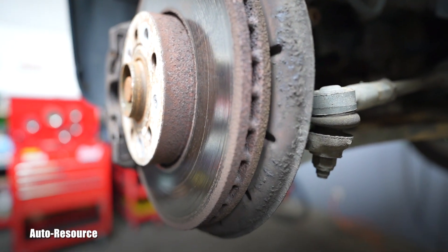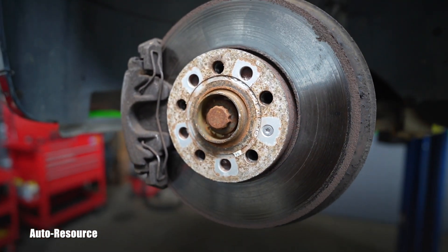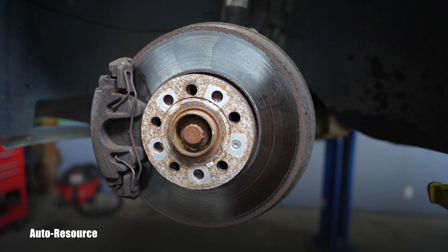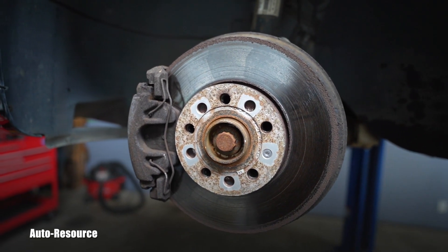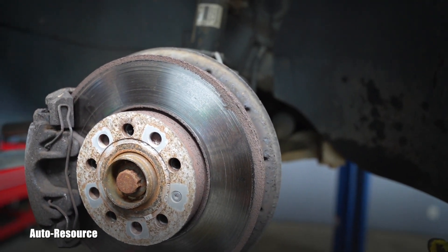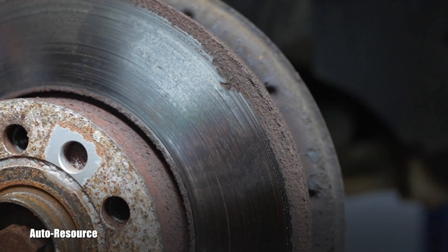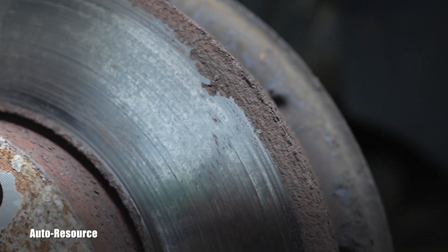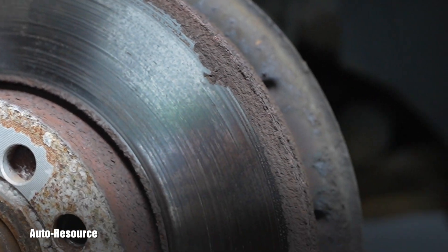If you look inside, there's a lot of rust. It doesn't matter that the brake pads, regarding the thickness, are almost brand new. There are many problems with rust and I want to replace the brake pads, but because of that rust, also the rotors. Let me show you this one part right here, and I'm sure you will agree — this is where the pads are braking on the rotor and the rust actually made holes in this surface.